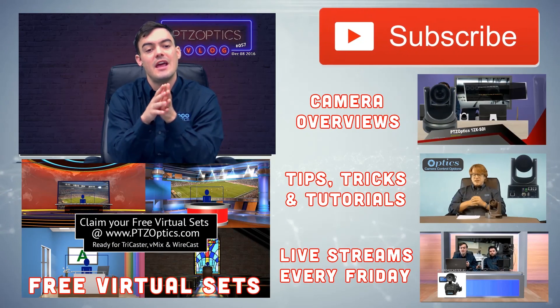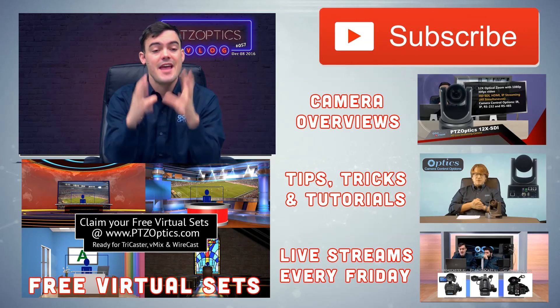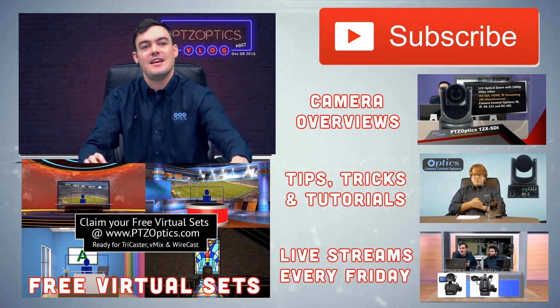That was it — two cameras, it does work for live streaming and recording. You might want to tweak your setup if you're planning to use the Skull Canyon with two 1080p cameras. Recording and streaming together gets you up to 70-80% CPU, which we don't normally suggest, so maybe just stream or record — one or the other — and let the cloud handle streaming. Don't forget to subscribe! The next video is how to host a live talk show with the Intel NUC Skull Canyon.